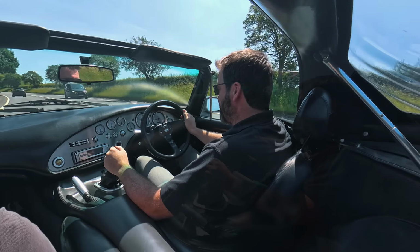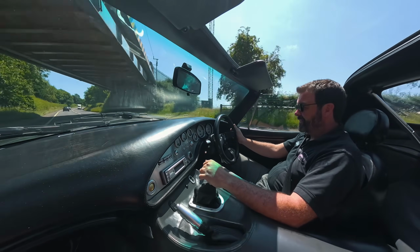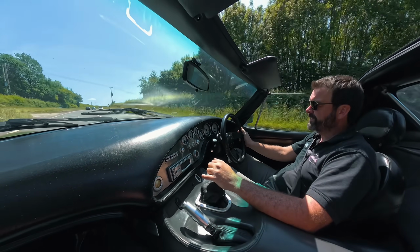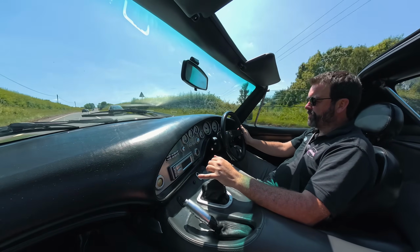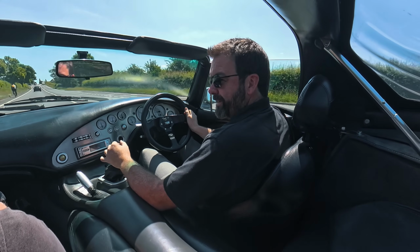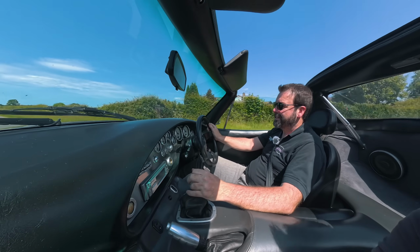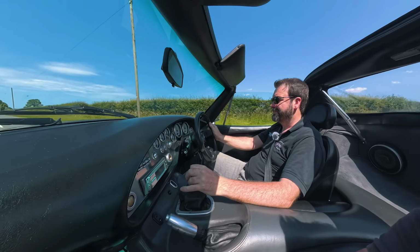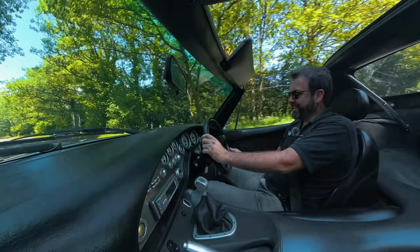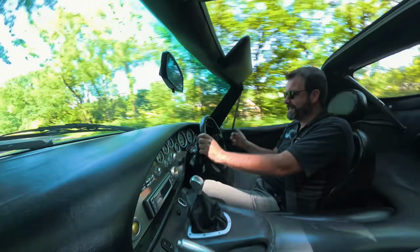Obviously, another benefit of this 6-speed gearbox. Now we're doing like 50 mile an hour, and we're doing 1500 revs. This sits at sort of 85 mile an hour, and it's doing 2000 revs. So for cruising and touring, they're just fantastic. You know, we're seeing sort of mid 30 miles per gallon on a run. It's just relentless. And you just think, well, I'm going really fast, and then just touch it again, and that torque just comes back again.